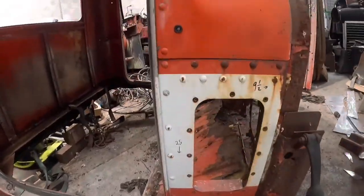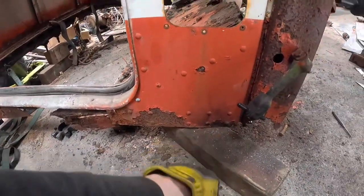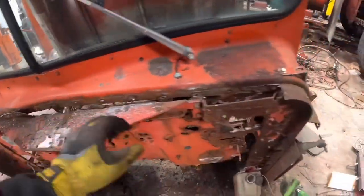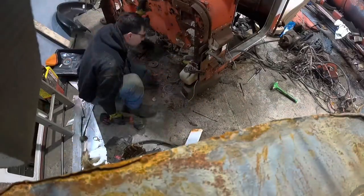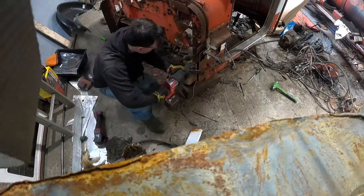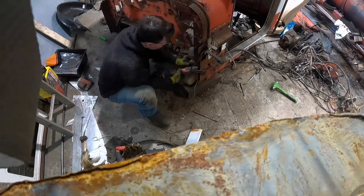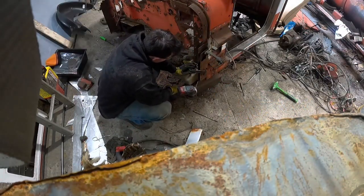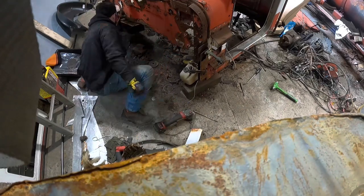So these are the rivets — you've got a row along the top, a row next to the door jamb, and two rows along the bottom. For the ones at the top put a downward slice into them with a cutting disc and then knock them off. The one right next to the door jamb you'll struggle with, but don't worry because that one goes into steel so just knock it off. Once you've got the ones along the top done and the ones down the side, it'll just come away. My power steering bracket had rusted and was clamping it — I didn't realize that. As soon as I cut those three bolts off along the top right-hand side it just came away; all that confusion was a waste of my time.